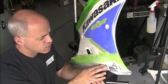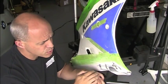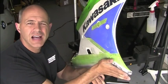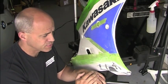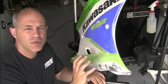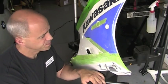This one actually took several coats of putty compared to the other side, which just took two and is really smooth. Some of the areas here have a real deep groove. Just blocking it — this great big patch here wasn't damaged, but it was sitting proud enough, there may have been a little warp in the plastic, that I've smoothed out. The whole thing should look good when it's done. If one coat of primer doesn't cover all this visually, I'll lay down two coats as if doing the whole paint job and then reassess. I'll let it sit and dry, re-tooth it on a sunny day to do the proper paint job.